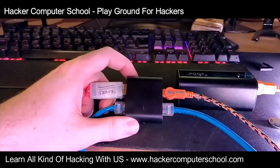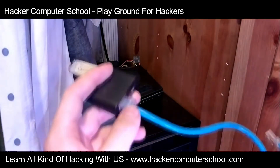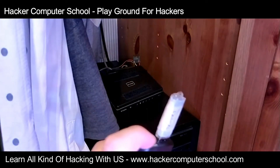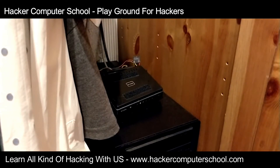Let's install this in my networking cupboard — it's basically just a wardrobe but it's where we'll install the Packet Squirrel. This ethernet cable side plugs into the PC or switch where you want to monitor. The black wire there is the actual internet connection going into that side. We're going to replace where that black wire was, put the black wire into the Packet Squirrel, and that means we'll be monitoring all the information going across the switch and that wireless router.